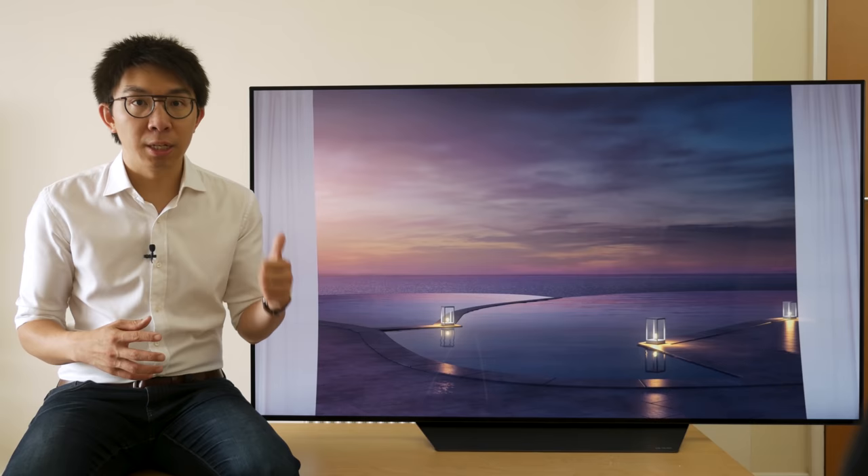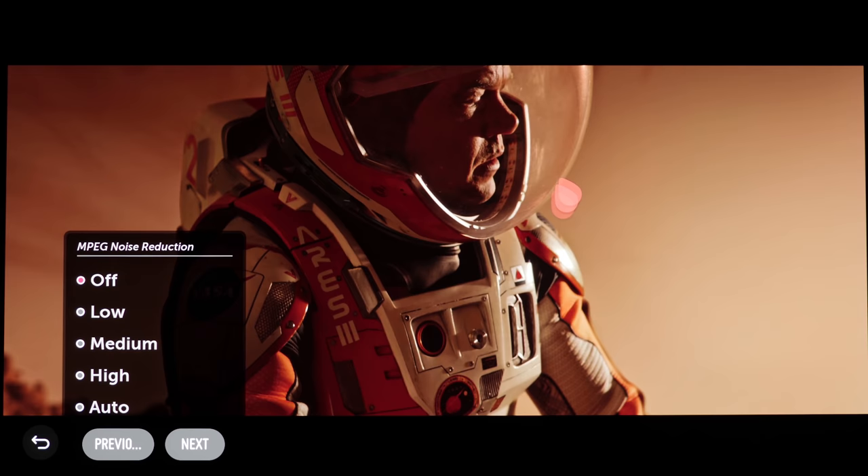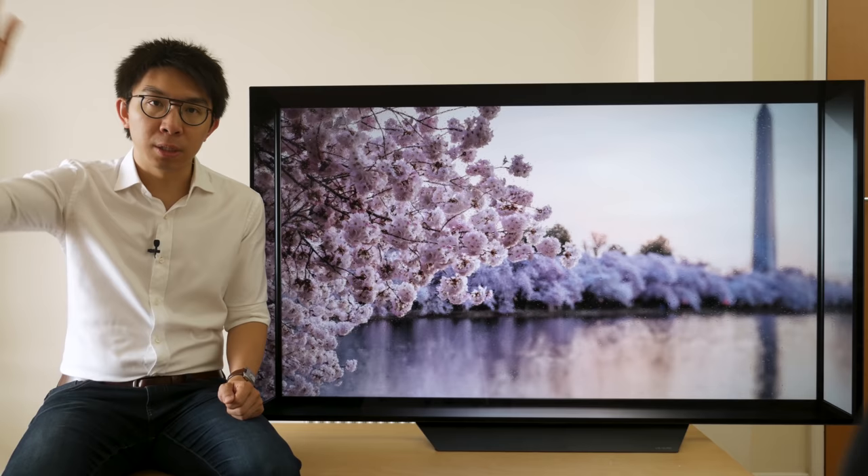On the video processing front, the LG B8 doesn't seem to have the decontouring filter implemented on LG OLEDs with the Alpha 9 processor, such as the C8, E8, G8 and W8 — probably because the B8 is only using an Alpha 7 chipset. If you've watched my review of the LG C8, you may remember that LG placed its decontouring filter under the MPEG noise reduction control. But on the B8, engaging MPEG noise reduction had no effect on smoothing out posterisation in a scene from The Martian. Because I'm a purist, I prefer not to enable MPEG noise reduction on LG's 2018 OLEDs since it also scrubs away some fine detail. Just be aware that the decontouring filter is available on the C8 but not on the B8.